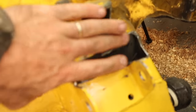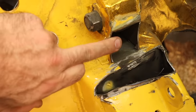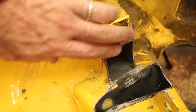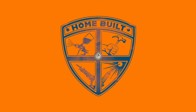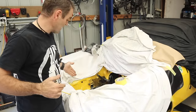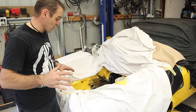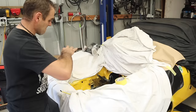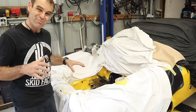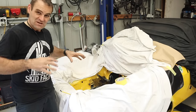I've cut out a groove which I can put a nice curved piece of 3mm plate into — this is only 2mm so I'll do the new one in 3mm to make sure it's super strong. But before I fill that in, I need to cut off this engine mount and move it back, which means doing the same on the engine mount on the engine. I'm making a plan on how to move it — I don't want to move it far because that's going to upset all sorts of things. What I'm going to do is put the engine back in, mark the engine in physical space, then put it back in with one engine mount missing and put it in the exact same spot so the new engine mount location keeps everything where it's supposed to be.